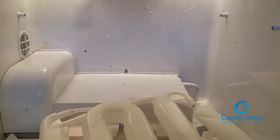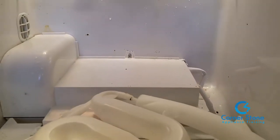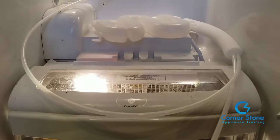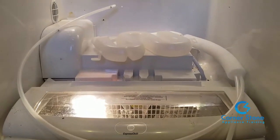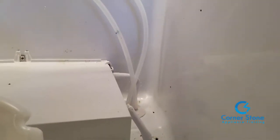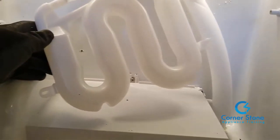This is the new water tank assembly we're about to install. I also cleaned all the black mold and debris from the base of the refrigerator — you should always do that before replacing a new part. Pay attention to the supply lines and where to insert them. The short supply line is on the right and the longer one is on the left. Feed them through until you line up the water tank assembly.